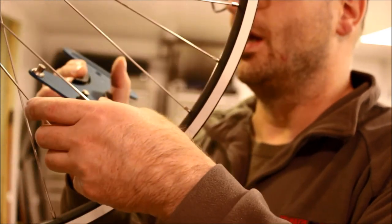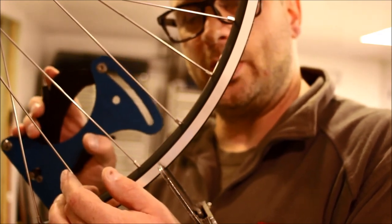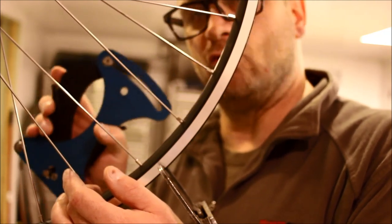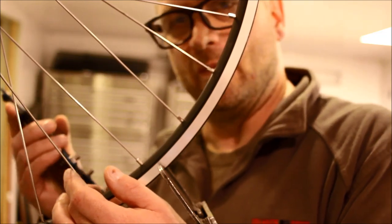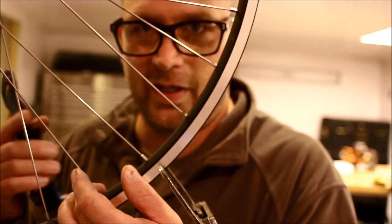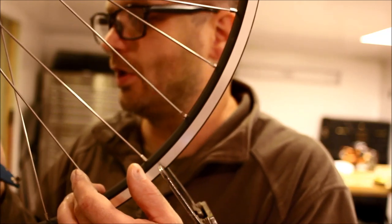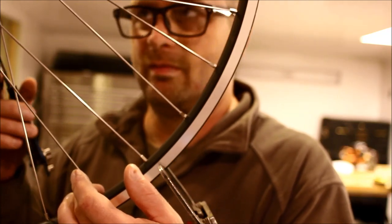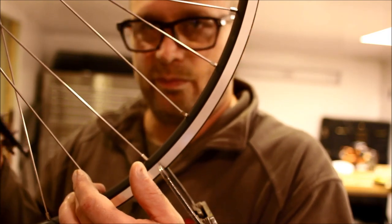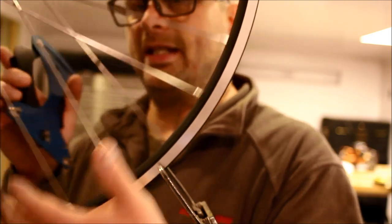This reads 16. As I explain in my other video, this number is totally arbitrary — it's just to the tool. I'll plug this along with 31 other numbers from 32 spokes into the app, and that'll tell me whether it's too loose or too tight. I happen to know I want to get values on this tool between 20 and 23 for this wheel to be properly tensioned. So 16 is not enough — I've got more tensioning to do.